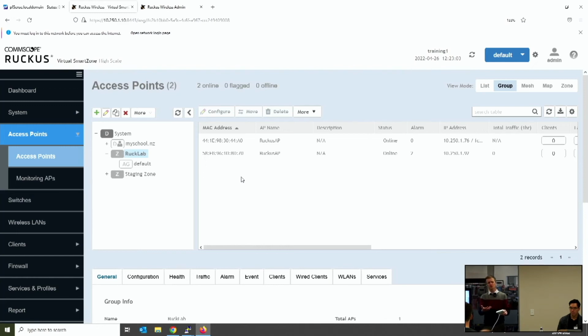This process normally happens automatically. The client device will automatically connect. If you've got the same SSID and same authentication options set, client devices will roam between zones without too much trouble. It's not ideal though, because you have to maintain 2 sets of Wi-Fi network configuration.